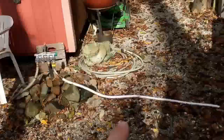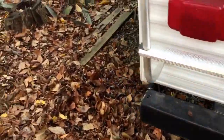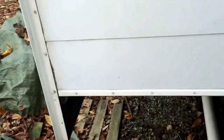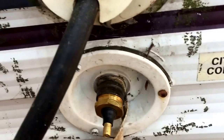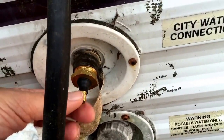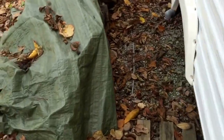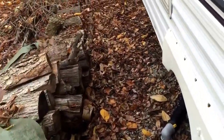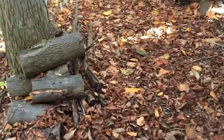I have unhooked my water and it's right here. The way I do mine, I don't run antifreeze, but I blow my lines out. So you get this little doodad right here — you can buy it at an RV place. It has a tire valve on it, so you take a compressor and hook up to this and set it at about 35 pounds. You don't want to put any more than 35 pounds on it for your lines.